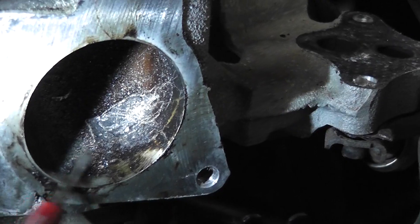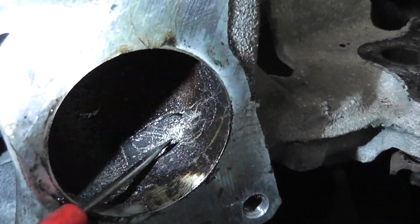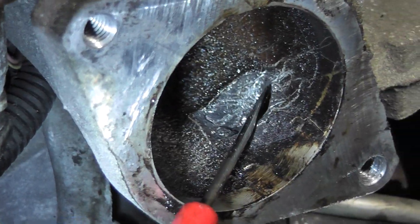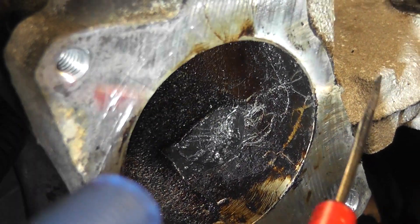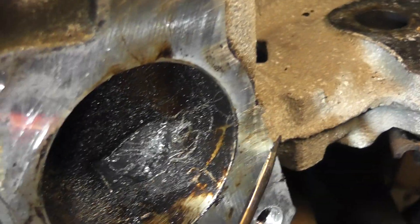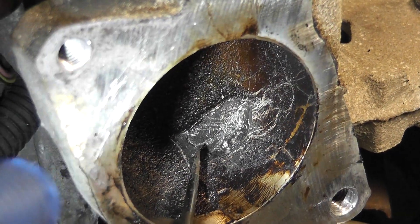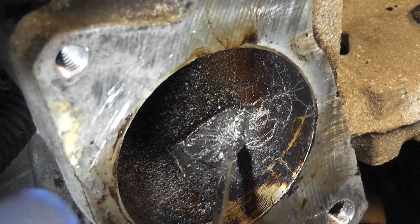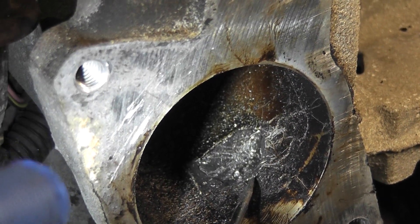This is the after. What's important is that you understand when you clean out this passage — you can see the passage is cleaned out — there's a smaller orifice inside, but it goes deeper in and it actually gets plugged up over in here too, so you have to get all this stuff out. We'll know if we got it clean enough once we bolt the EGR back up, bolt the throttle body back up, and redo our flow test. I'll show you the after result as our final confirmation. I worked with it as much as I could, got as much out as possible — I think we're going to be okay.